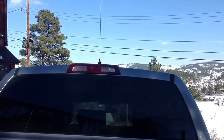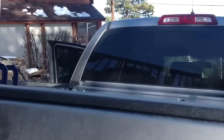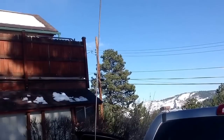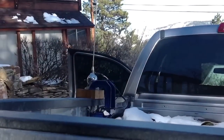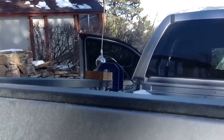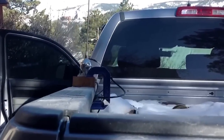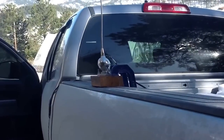On top of the vehicle there is a two-meter whip — five-eighths wave, two-meter whip with a mag mount on it. And here is the CB whip, chopped off — one foot chopped off to make it eight feet long instead of nine feet, so it'll directly resonate on ten meters. That is one heck of an effective antenna on ten meters. With the PALSTAR I can force-feed that thing and make it take power all the way from 40 meters up to 6 meters. It might even work on 80 meters, but I generally do not drive at night and 80 meters is a nighttime band, so I don't see the point — it would also be extraordinarily inefficient.